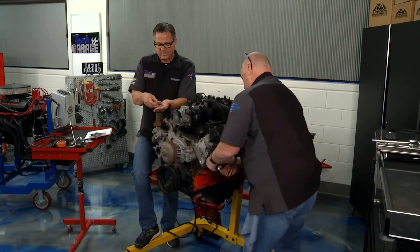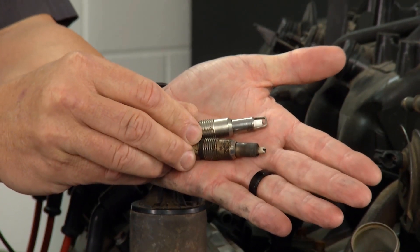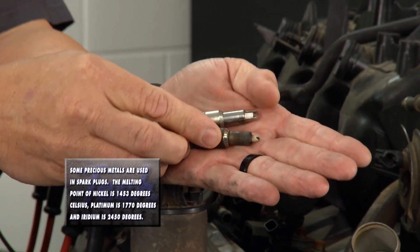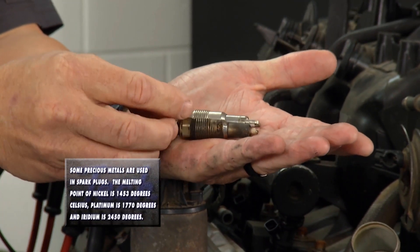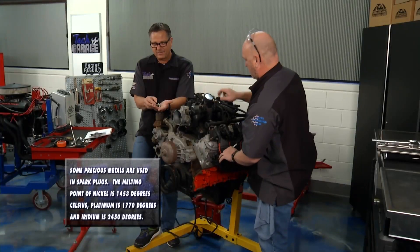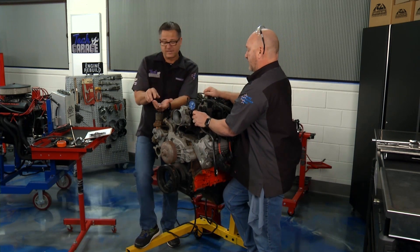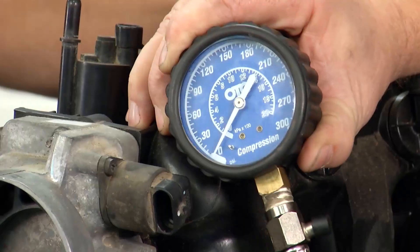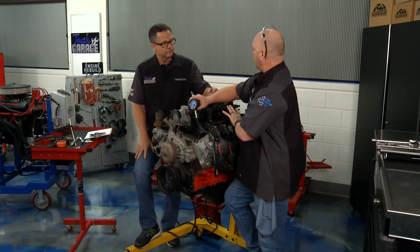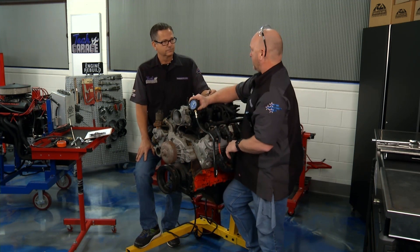We also talked about that lean condition on today's show. If it got too lean, you can see a spark plug right here — this is actually an original one. Look at that electrode: it's totally toasted off. That was a dead miss. If that was happening in this engine, we've got to really suspect that cylinder it came out of. I love that pre-investigation because what it tells us is, as we disassemble later on, we'll be looking very deliberately for evidence we found right here, right now.